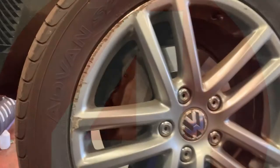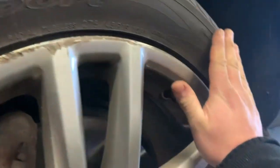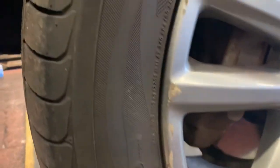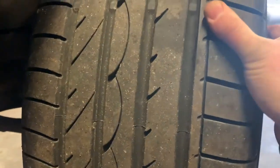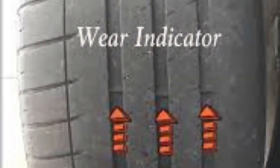The fourth one is tyres. When checking tyres, start with your valve and check its condition — look for any big splits. Then check all your road wheel fixings to make sure they're all in place. Check the sidewall for any big deep cuts or bulges. If you can turn the wheel pointing outwards — easier with the front — get someone to drive forward slowly and check for any cuts, nails, or anything like that. Deep cuts down to the cords would be a fail.